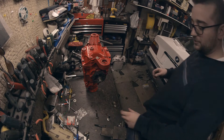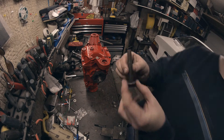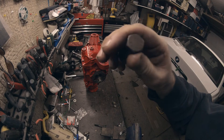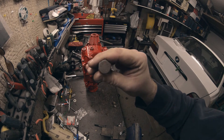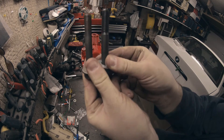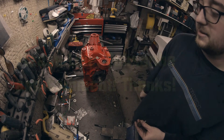The real issue with the other diff wasn't the diff itself blowing — it was one of the bolts that holds the diff to the car. This is what it used to look like. At the top it tells you the bolt's strength: that one is 10.9. We decided to see if we could find something stronger. Technically it's the same bolt rating, but we're still putting new ones on — the body is a little thicker and they haven't been exposed to 20 years of stress, so those are definitely the ones we're gonna use.